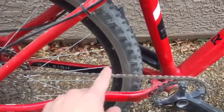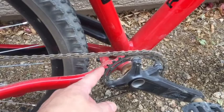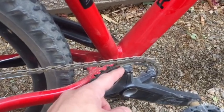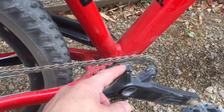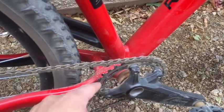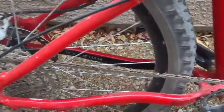So that really makes for very steep chainline angles with that 52 millimeter. So I went ahead and used spacers. So I used 4.5 millimeters worth of spacers here. I've got one nylon spacer and one metal washer. So that brought my chain line into 47.5 millimeters. And right now it's set up perfectly.